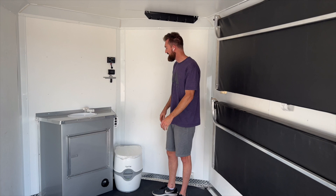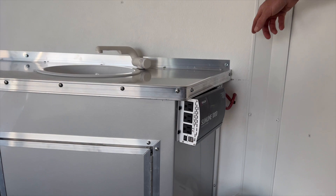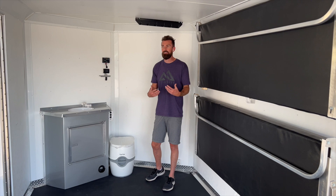We added a slimline power inverter — a thousand watts of power running off your batteries. It's piped into the battery outside in the box; turn it on and it gives you 110 power at all three outlets without being plugged into anything. It converts 12-volt power to 110 for all your accessories. There's also a water-flush toilet right here, so you can use the bathroom without the composting toilet smell.